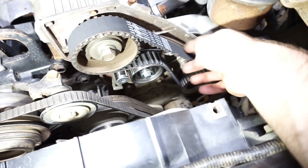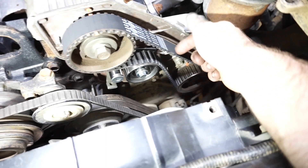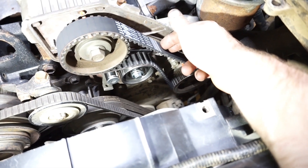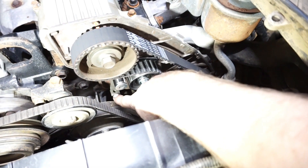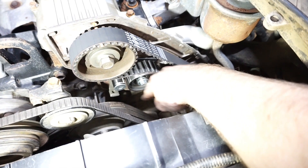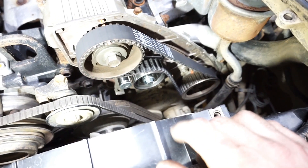When you're putting the timing belts on, you want the slack to be on the tensioner side. On the side where there's no tensioner, it should be rather firm to push down — there should be barely any slack on that side. Now I'm going to put the spring on. There's a spring that goes from here to a little pin down here, and that'll put some tension on this tensioner pulley. Then I'll be able to nip up both the bolts.